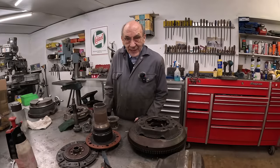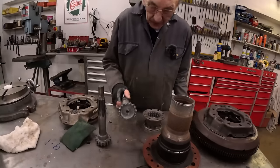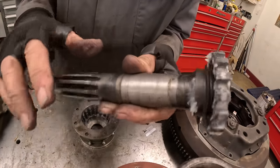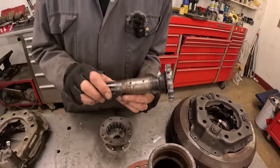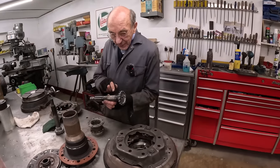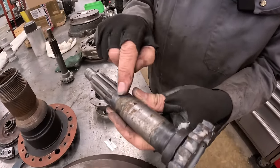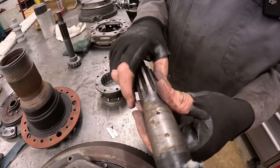Right, this is a lesson on getting it done. Bodgery, really. This was the original shaft. That came out of the Mercedes, and that came out of a Bentley. So to make the thing work, we had to join that to that. Now, we're talking about a 10-litre engine with masses of torque. So what we did was, this is almost like one of them videos you see in India. We turned that one down, and we turned that one down, and we made a sleeve, and we pushed it all together, and then we silver-soldered it.